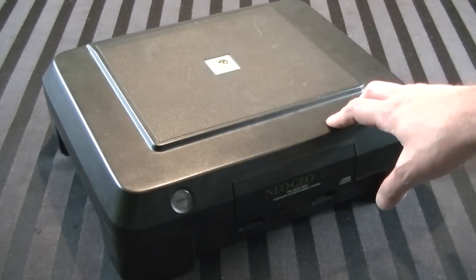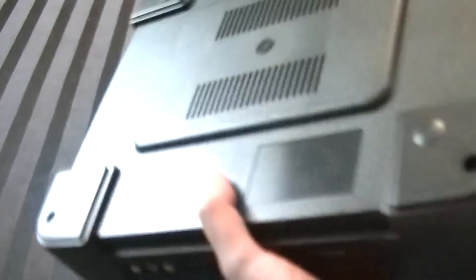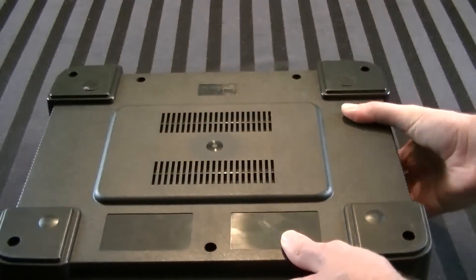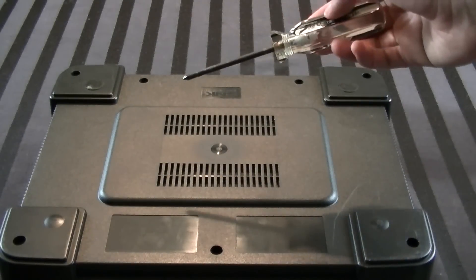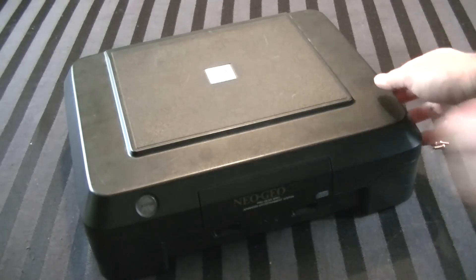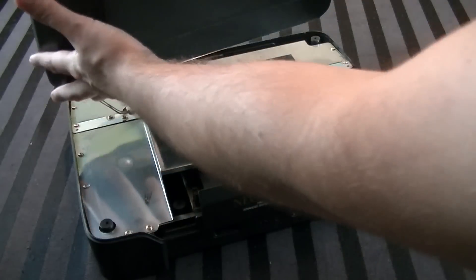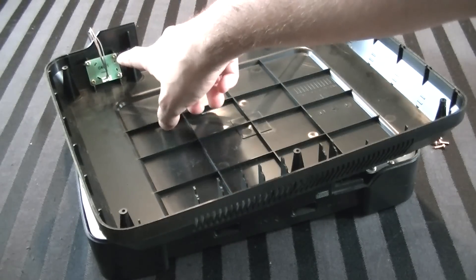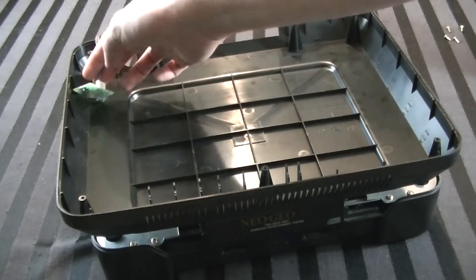The very first thing to do is flip it over - you'll see there are seven Phillips screw points: three on the bottom, four on the top. Take a standard Phillips screwdriver and remove those. Once the screws are out, take the lid off. Be careful because there is a ribbon here connecting the lid. Flip it over and you'll see a little board at the back - this is the power button, held in with four Phillips head screws.